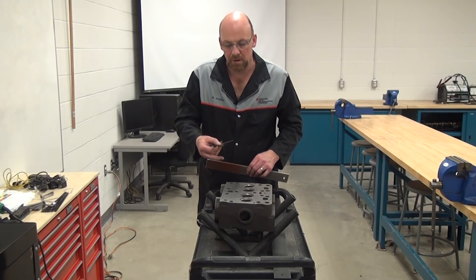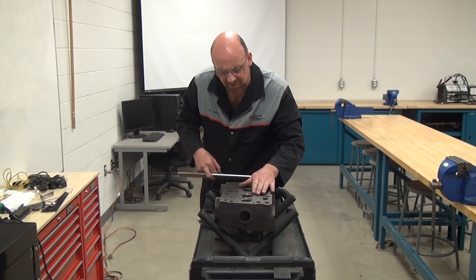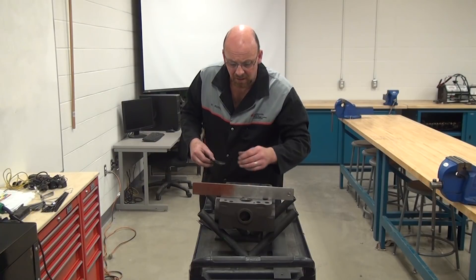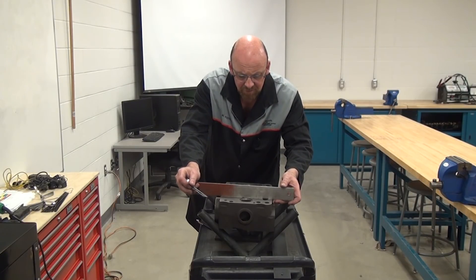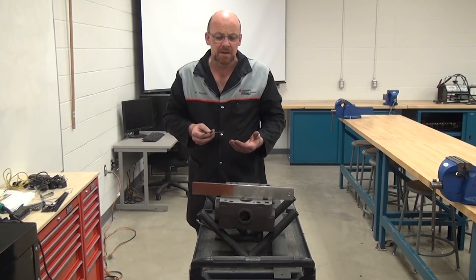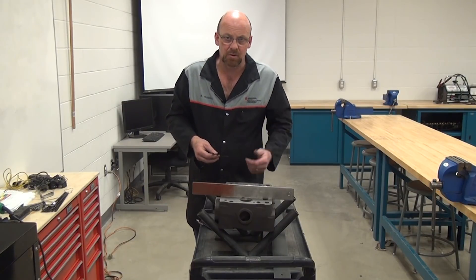I've gone ahead off camera with the electric sander and really went hard on this to see if I could get the surface a little cleaner. There is quite a bit of small pitting from rust, but there are some nice smooth spots. It doesn't look like the liner has been hammering into it, so I think we're going to go with these heads. Based on the last measurement of half a thou distortion — which you can see in the light — there is still a little bit of movement, and I put a half-thou feeler gauge in there, which is way below any minimum specification. It's usually three thou for every individual combustion chamber, but no more than six cumulative on the head. So if I found up to six thou distortion between bend and twist, it would have to go to the machine shop and be decked.